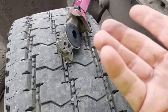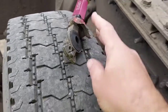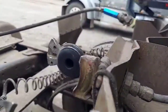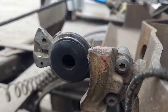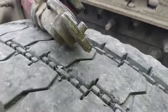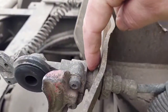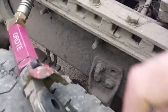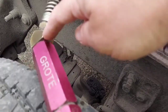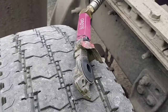First, you do want to do a general inspection. You want to look at the rubbers, make sure they're not chunked out or missing or just folded up. Neither of the glad hands are cracked or broken. And the glad hand — it's not leaking from here or back here, it's not leaking here or here. It's specifically here.